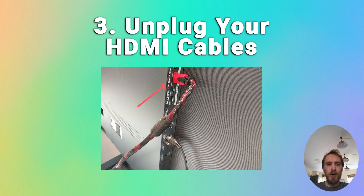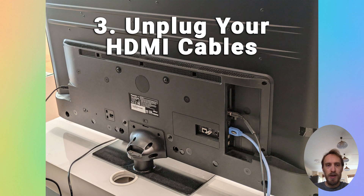About 5% of users have an HDMI problem — either a faulty HDMI cable with a break in it, a damaged HDMI port with damaged or broken pins, or a poor HDMI connection between the cable and connector. Start by removing all HDMI and other cables apart from your power cable from your TV, then switch your TV on. If the problem's gone, look at all the HDMI and other cables, check there's no damage to them, use compressed air to clean the contacts, and then firmly reinsert the cables and switch your TV on again.